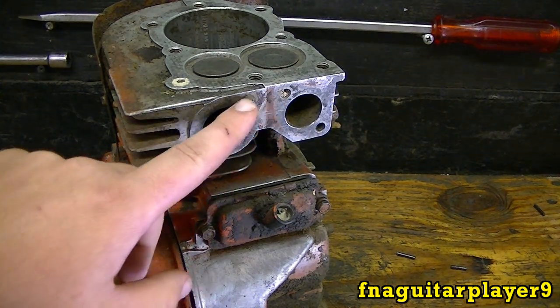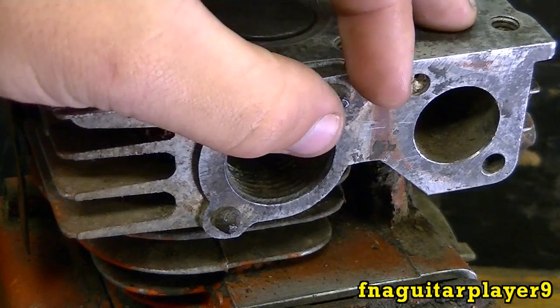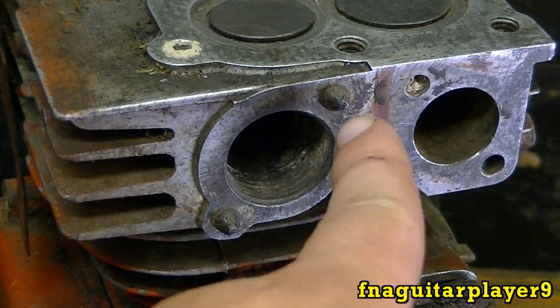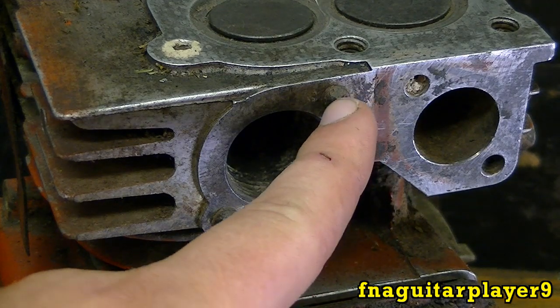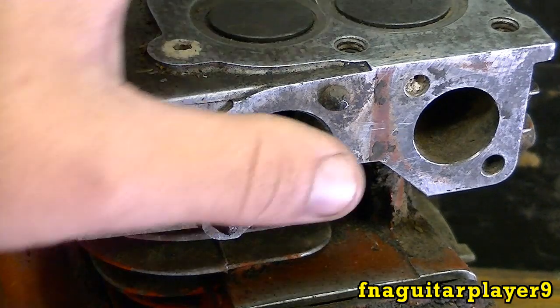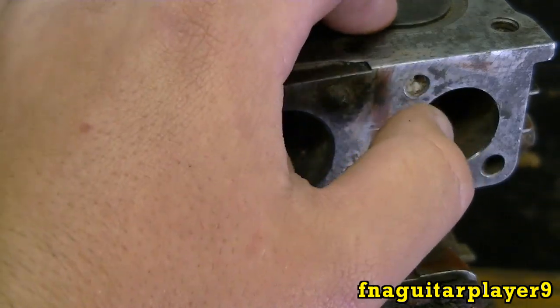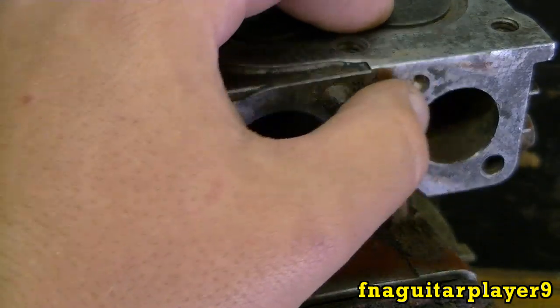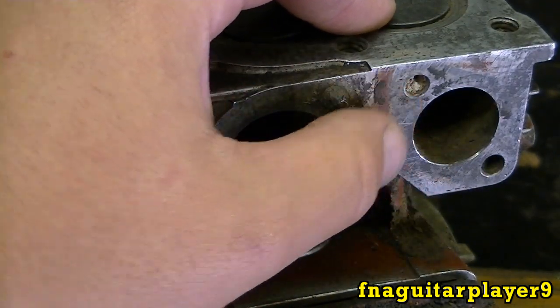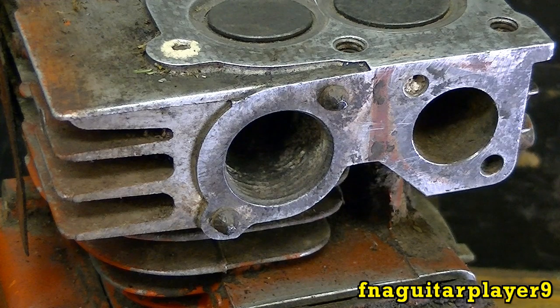Basically all you got to do is — on this one since it's been sitting — I'm going to grind this down so you get real clean metal, and we're going to weld a nut on here, keeping the arc in the middle part so that all the heat gets on the bolt. That way it'll help break up whatever's made it stick. Then you can get a socket on it and loosen it right up, hopefully. This is also true if you've got a broken bolt that's flush — you get the welder, I'm using a MIG welder, a flux core, and you'll be able to get that wire going right down inside there on top of it. And since the block is aluminum, you don't have to worry about the nut getting welded to the block itself. The aluminum might melt a little bit, but it shouldn't really matter.